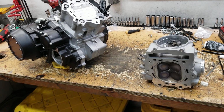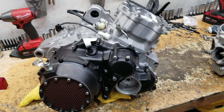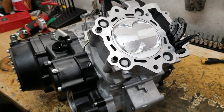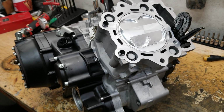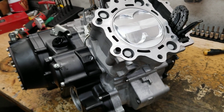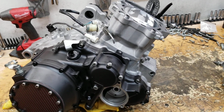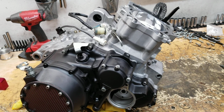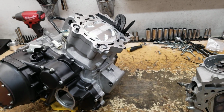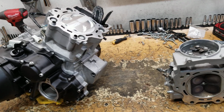So what it consists of is a stroker crank. This specific one is a 7 mil with a 1055 big bore. Now this combination is a bolt together combo. There's no clearancing of the internals on the engine, as well as the cylinder just drops down in the case. There's another combo we do, which is an 804cc, which is an 8 mil, very similar setup, as well as a 6 mil we do. And they're all kind of capable of that same range. The 6 mil is not specifically set up for pushing this power range. We normally do this on the 804 engines.